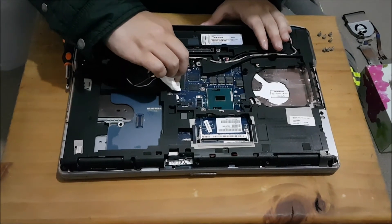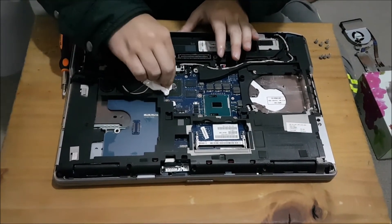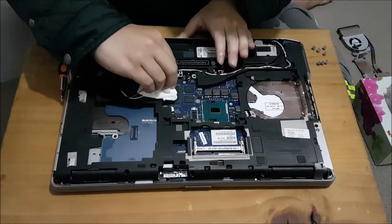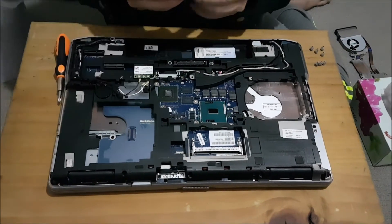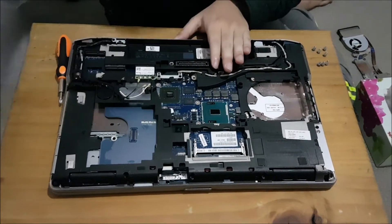Please be careful when you're removing it and lifting up your tissue, as you might get some thermal paste dropping back down onto your motherboard. Normally I would not use tissue as tissue breaks down — I normally use a towel or some harder tissue.